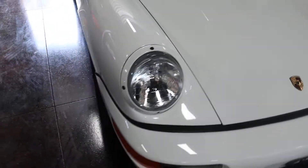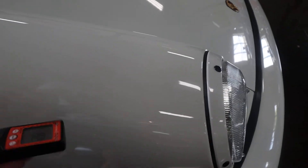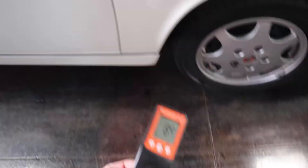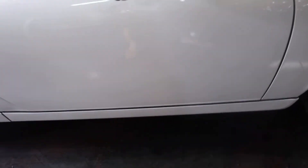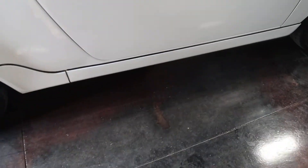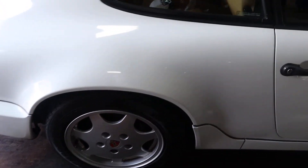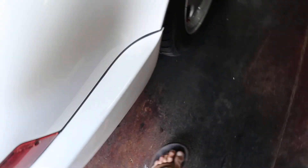So I'm guessing just factory paint or factory with some touch-ups — could be cosmetic. That was an 8.2 and 8.9, so higher on this fender. But again, factory zinc drips. The doors reading 4.3, passenger door 4.3 — so you've got two doors that are factory paint, which is important for safety. Front fender, and both your rears are factory.